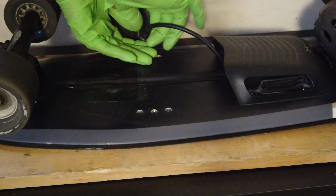I'm sweating like crazy. My new XR battery replacement is connected and screwed on tightly. There doesn't seem to be much of a gap after you tighten it with the screws when you line up the wires snugly in the groove that's made for it in the battery, so I shouldn't have a problem there. That's a fix for you. If your battery's not fitting snugly, and there's a little gap, make sure the wire is fit snugly in the groove.